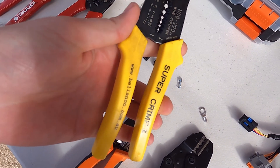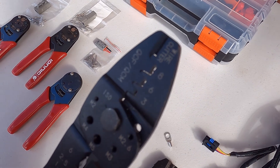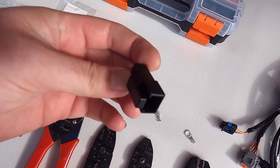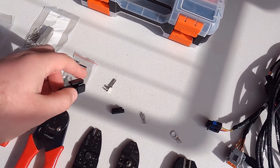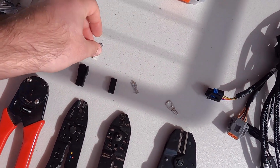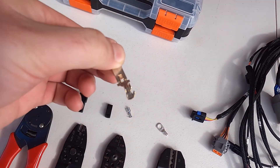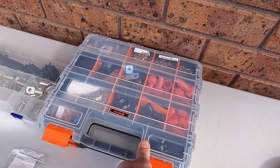This tool is one of my favorites — I've gone through a couple of these. It's for the larger gauge stuff. This is a fusible link connector — I use this for powers. It can handle up to 60 amps and these connectors can push 20 to 25 amps. You'll see the difference in the terminal: it is larger and the tangs are larger. That's my go-to for that.